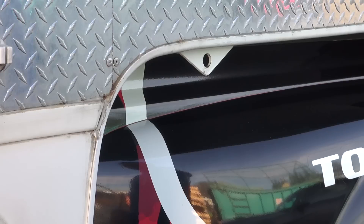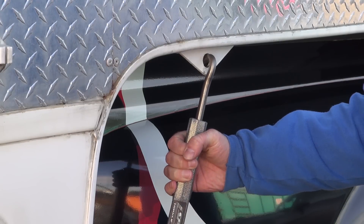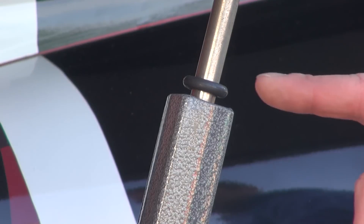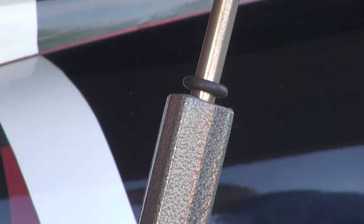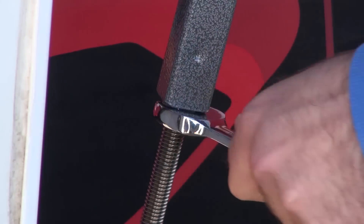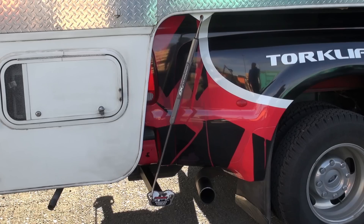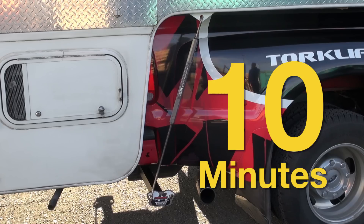To install, bolt the hook bolt into your tie-down bullet plate. Hook the top end of the hook bolt into the camper anchor point. Hand-tighten the spring-loaded XL, and make sure the O-ring is within a quarter of an inch from the turnbuckle body. Tighten the bolt to ensure the spring-loaded XL is in place. Installation is now complete, and takes about 10 minutes to install a set of four.